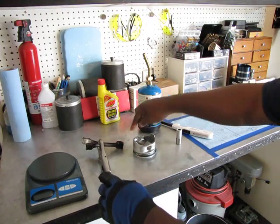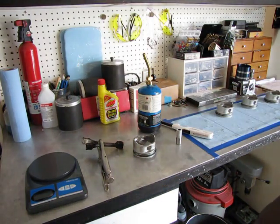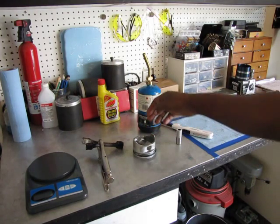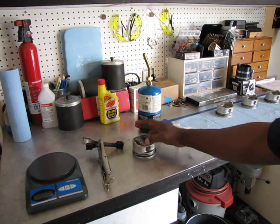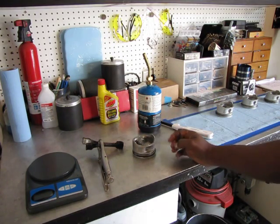So I'm going to heat this up. I don't want my pin to warm up too much. And then when it turns blue, I'm going to put it in here with the vise grip, slide this through and center it with my fingers, because the piston won't be hot and this pin definitely won't be hot.